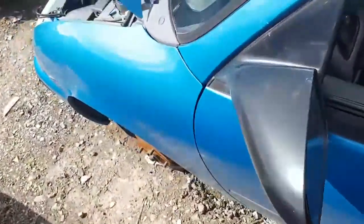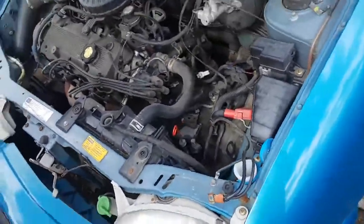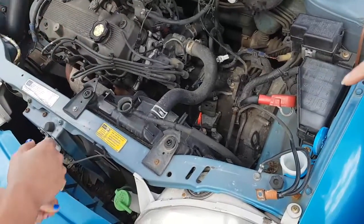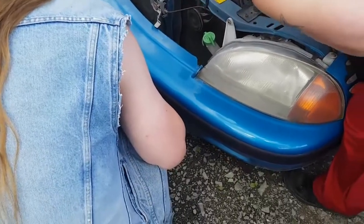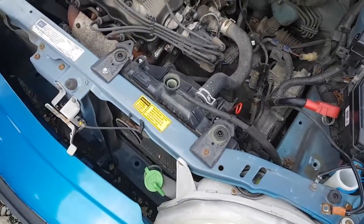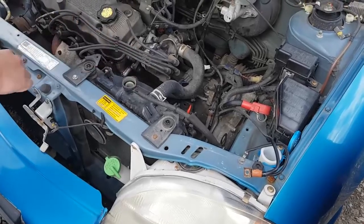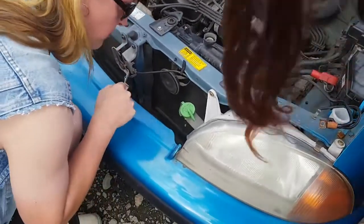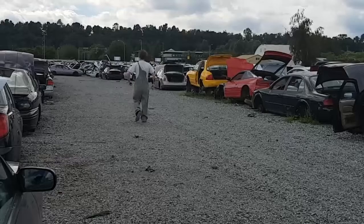Just because the car looks like it was in good shape and it says it was a runner. Well, I need a tranny too - your transmission's going in that thing? The front of the fins looks about average, not super bad. It's about normal - way better than the ones we were looking at before. Look at the whole car, it looks like it was in good shape. You don't need to get underneath to take it out - you take these two bolts here off and then the whole thing lifts out after you undo the hoses. The fan comes out with the rad. The rad's probably just sitting on a little shelf at the bottom. I'll go grab the tools - we found a radiator.